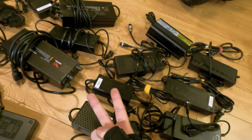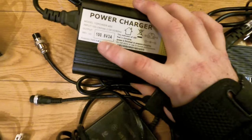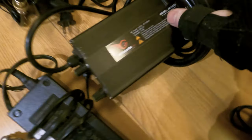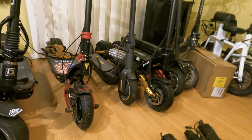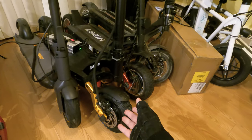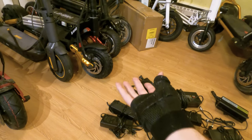The second thing that differentiates the chargers is the voltage — the nominal voltage that these chargers will push to the battery when you plug it in. You can see on most chargers it'll just tell you: this is a 100-volt charger, this one says output 58.8 volts at two amps, and this one says voltage 84.2. These are all different voltage chargers because all these different batteries run at different nominal voltages — the Dualtron Storm is a 72-volt scooter, this is a 52-volt scooter, that's a 48-volt scooter, and we've got a 60-volt scooter.